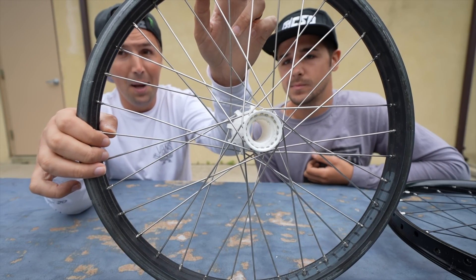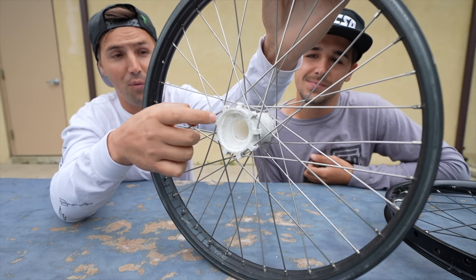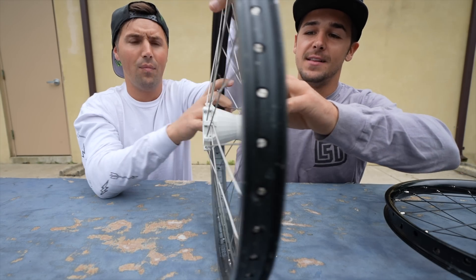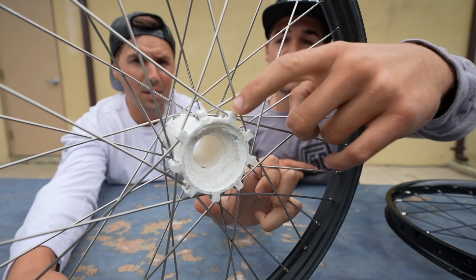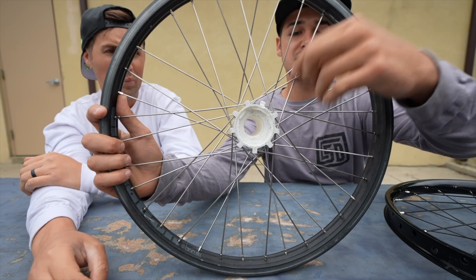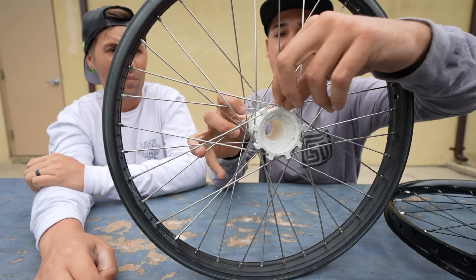Because of the size difference between the two sides, Maddie had to get creative and came up with a combination that uses two different spoke types. The normal side uses regular J-bend spokes, while the other side uses straight-pull spokes. He chose straight-pull because when 3D printing that side standing up, stacking the most material allows better adhesion, and straight-pull spokes exert less pulling pressure — no hooking and yanking like J-bends do.